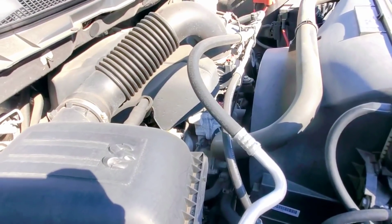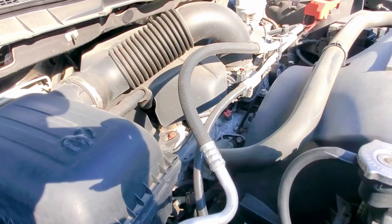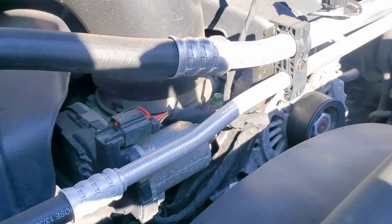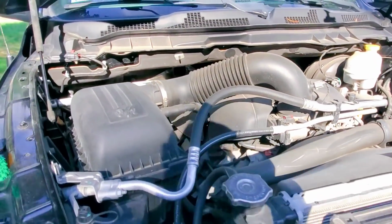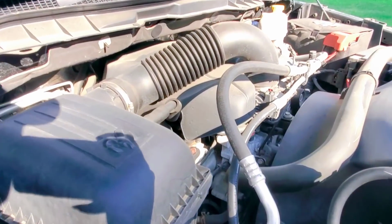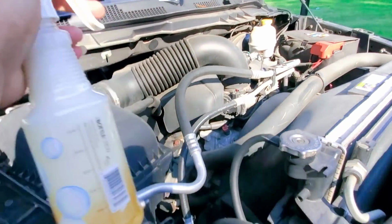But in my opinion, and I'm not an expert, what you shouldn't do is power wash it, because you have connectors all over the place, wires and everything like that, and some of them are exposed, like fuse boxes. A pressure washer will get water in there, and it doesn't take much to short something out or corrode it. So you can spray with water, but mist it like I will do. I think that's pretty safe. And with the soapy water, there shouldn't be any issue.